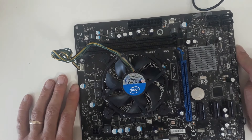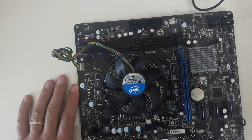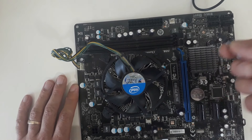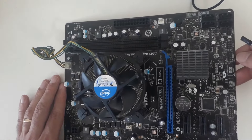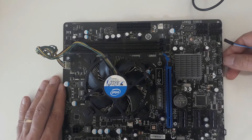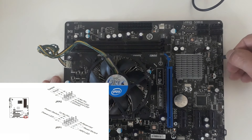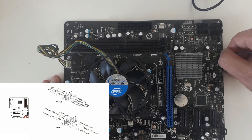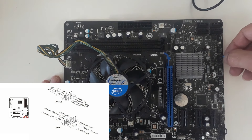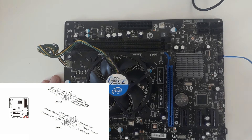To check what the problem of this motherboard is, I use an LED and a power on/off switch. You can get a power switch like this from a scrap computer case. There is a front panel jack on every motherboard — you can place this switch on it and turn on the motherboard easily. I place the power switch on the front panel jack. For a power switch, it does not matter which end, positive or negative, is connected to which end on the motherboard — its task is simply to connect and disconnect the power.